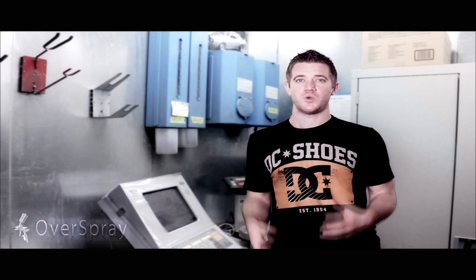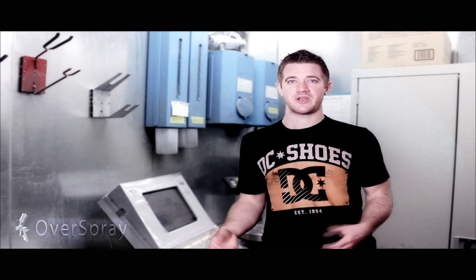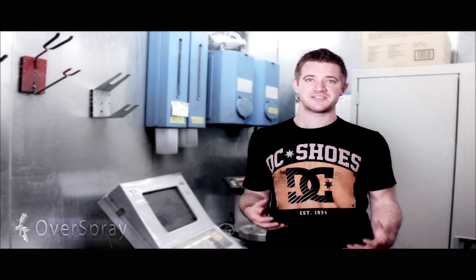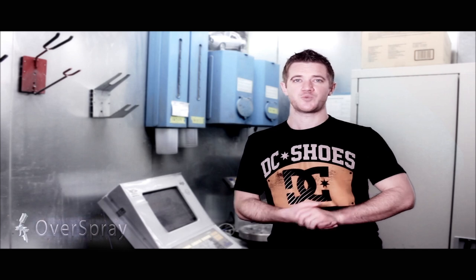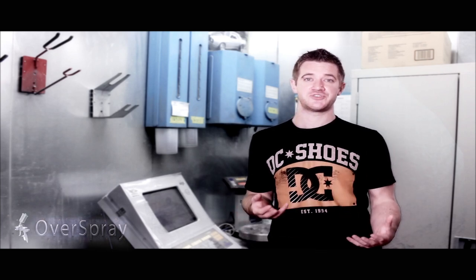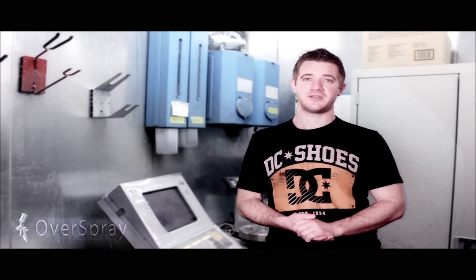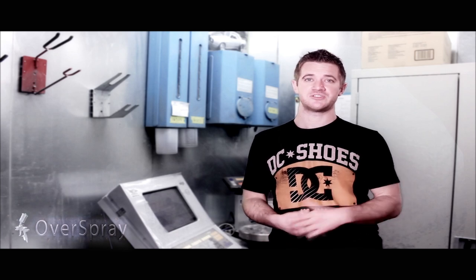A common question at this point would be: what's the difference between an etch primer and an epoxy primer, and what's better? The difference is really how the product works — an etch is an acid that bites into the metal, whereas an epoxy primer has great adhesion to the metal and works to create a watertight coating. One isn't necessarily better than the other; it's more about what's going to work for you and be more productive. They both differ in certain attributes such as speed and compatibility. I find epoxy primers to be more user friendly whereas etch primers are more productive, though as a generalization that's not always the case — it really depends on the job at hand.